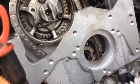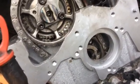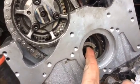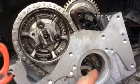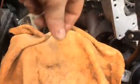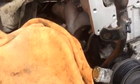You can see the main sort of cog down below there. That's a bit of a tensioner. There's no tension on that at the moment. That will move back into position and hook up to the diesel pump a bit later on. And the little tensioner there. The chain tensioner, the big nut, needs to go back in there nice and carefully and be torqued up.